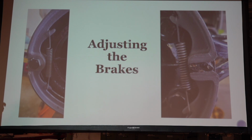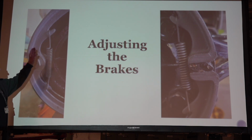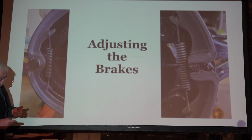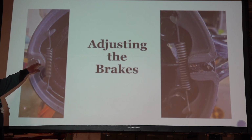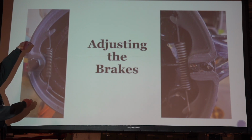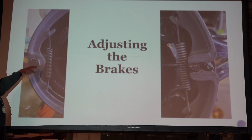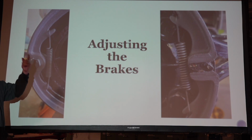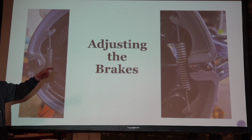I'm glad you mentioned that. That's something I forgot to mention. I told you I was going to, and then I forgot all about it. When you put this spring on here, turn it around. Put the hook this way, not this way. When you break this shoe, it's going to fold that way. If the shoe broke here and you have it like this, the shoe's going to come out at you, and I think that's when you groove the drum.